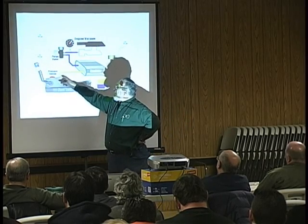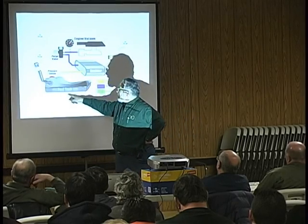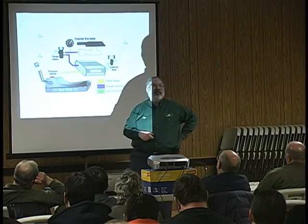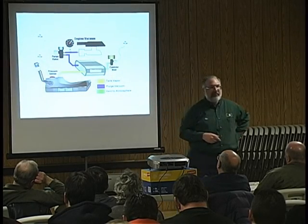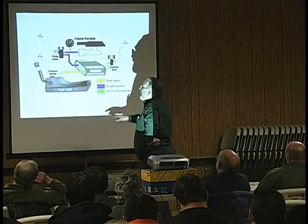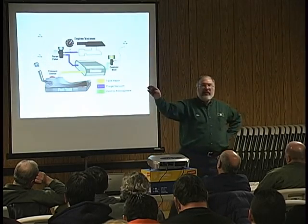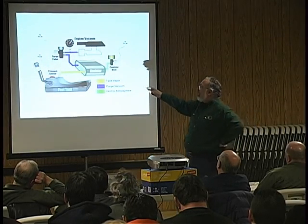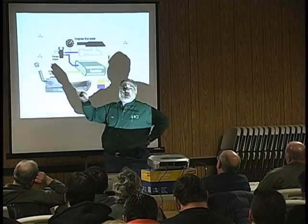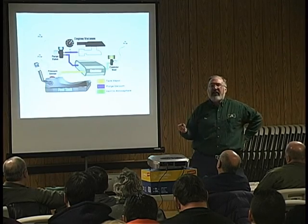and when this thing comes down, of course it doesn't look like this, I had a great picture here. It actually comes down, goes along, and then goes back up. Inside this line was liquid gasoline. So the gasoline was acting like a plug. So the car, which is not smart enough, says, hey, I'm putting vacuum back there. The pressure sensor says I'm not getting vacuum, I have a leak. But in fact, I didn't have a leak, I had a plug.